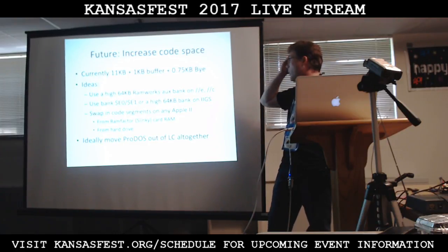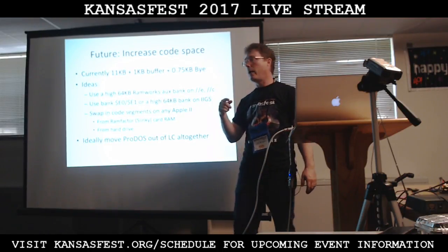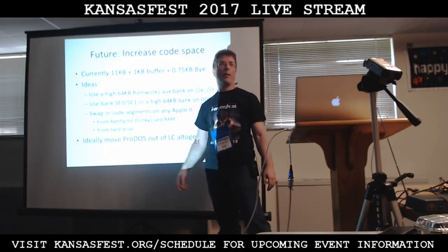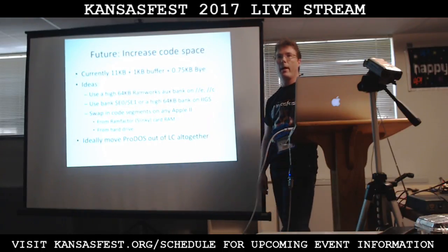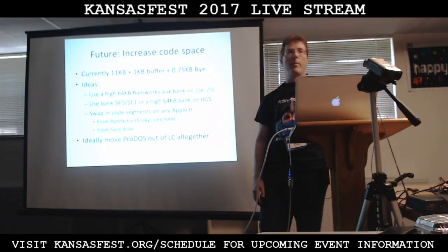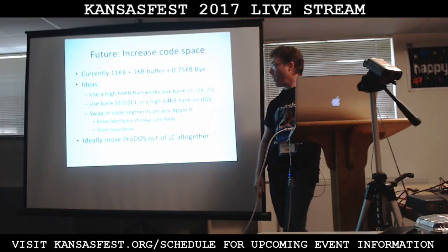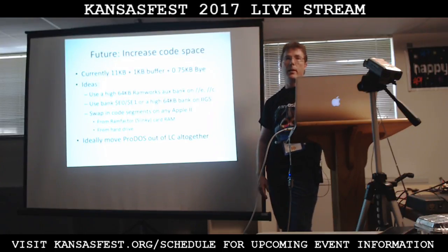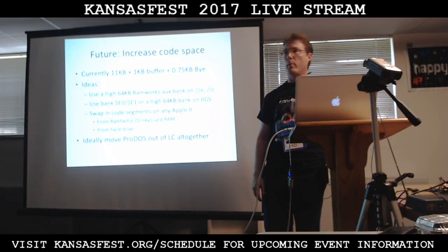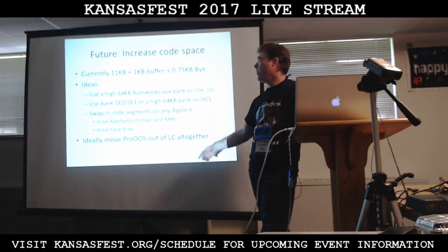Anyway, so ideas. One of my ulterior motives with doing that RAMWorks driver is, hey, if we get an extra 64K, that'd be a lot more memory than 12K. There's lots of stuff we could do if we had a whole extra bank. And the RAMWorks may have been hard to come by back in the day, but they're pretty affordable and available nowadays, so that seems like it would be a good thing. And on the GS, of course, we have typically lots more memory. It comes with 256K, so we could use one of the high banks or extra memory there.